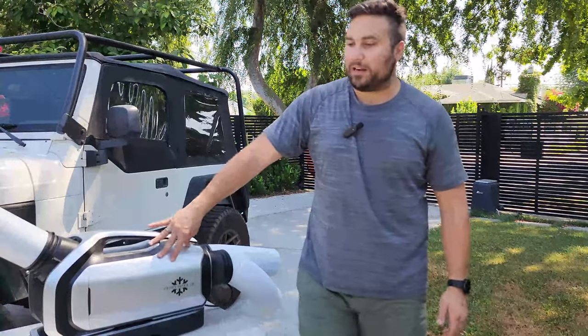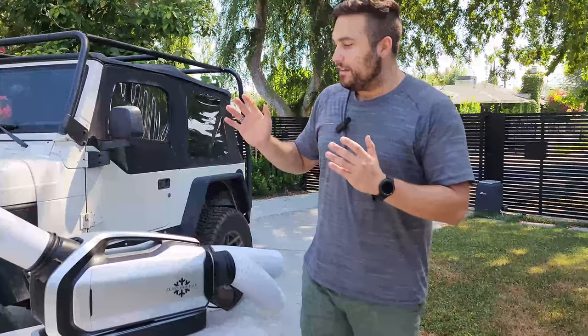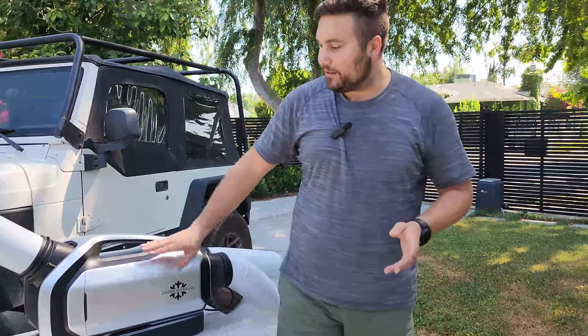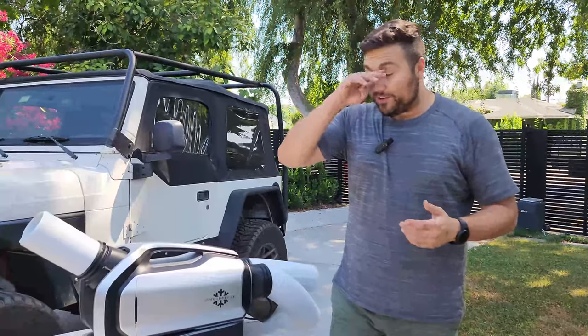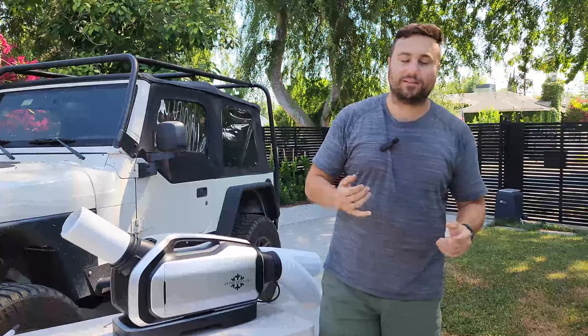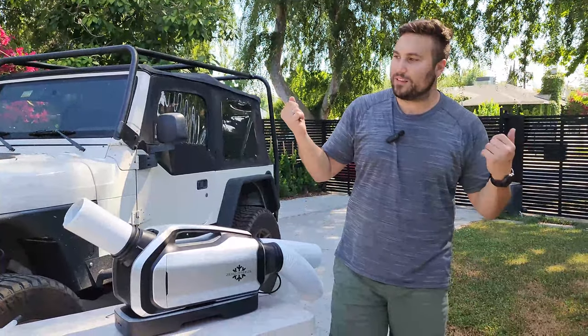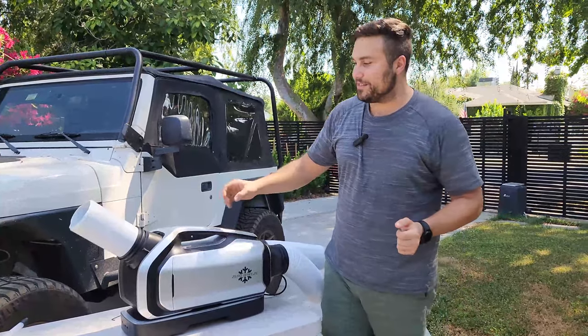But one thing to note is that since this device generates a lot of heat, you have to have a place for it to vent that heat. If you just plan on putting this as is inside of something, inside a unit, it will actually make everything warmer, because it's not only generating exhaust, but the device itself gets hot as it's trying to cool down the air. No energy in this world is free. When you consume energy, you generate heat. And when you try to remove heat from the air, you also generate heat. So you do want to exhaust this thing properly.